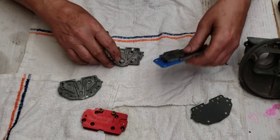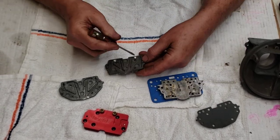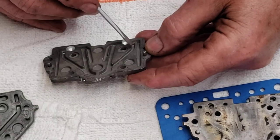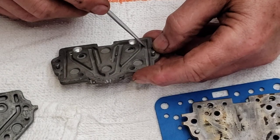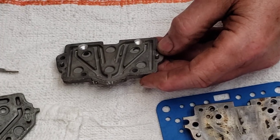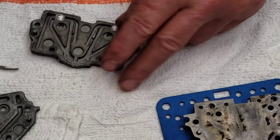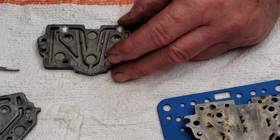This was just a quick short video. Remember, this is the idle circuit right here — that's the idle fuel restrictor right there. That's going to increase fuel to the circuit. It's just a metered circuit on most of these unless you put a meter block in them, in which case you would do away with this. All right guys, if you have any questions leave a comment below and y'all have a good day.